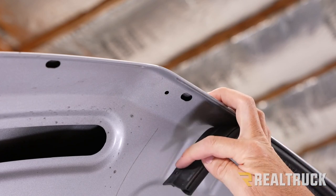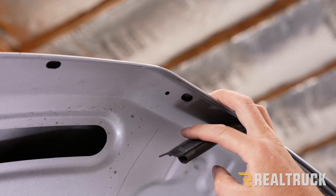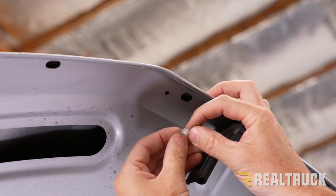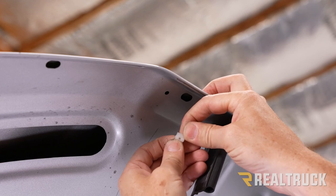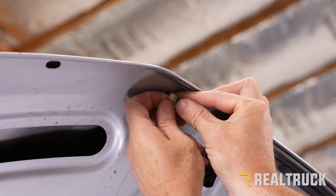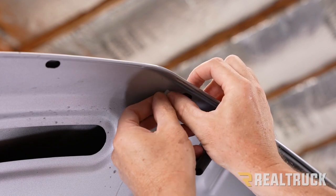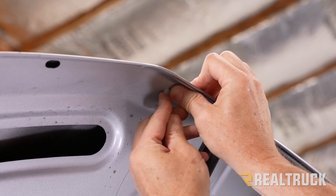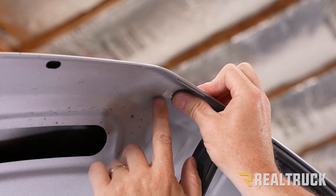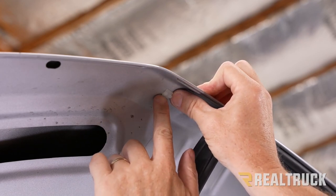Now where each of the four plastic fasteners was, go ahead and pull back your gasket and expose that hole. You're going to have a hole plug in your kit — one side is round, that goes toward the hole; the other side has a little rectangular shape coming out that needs to go side to side. Fit that up into the hole. When the tang comes back over, the tab is going to line up to that rectangular hole.